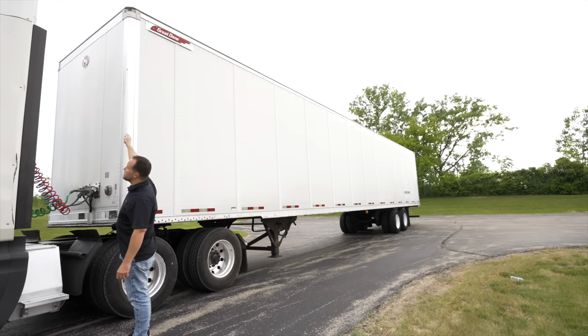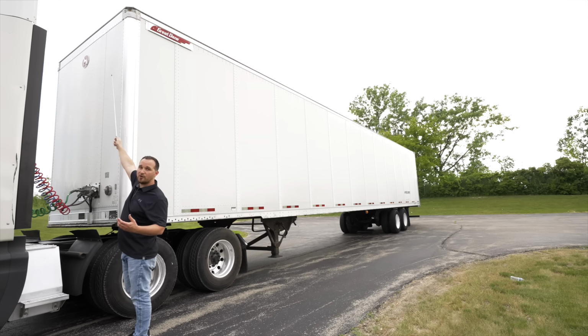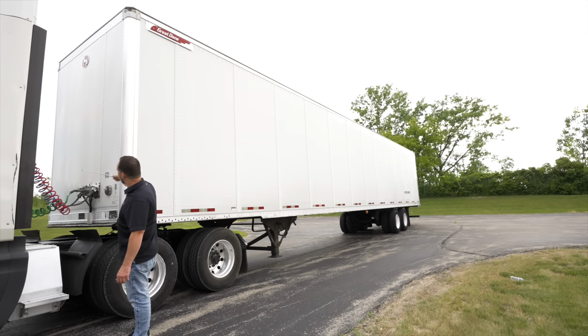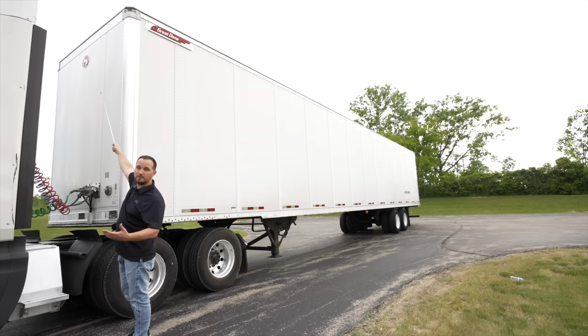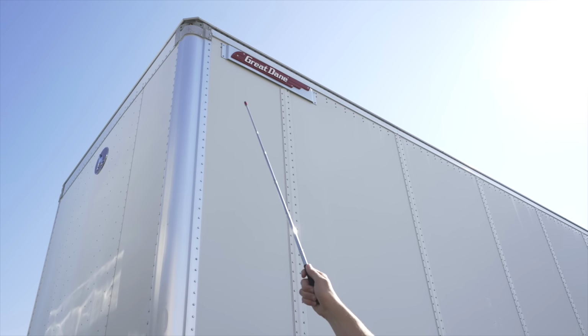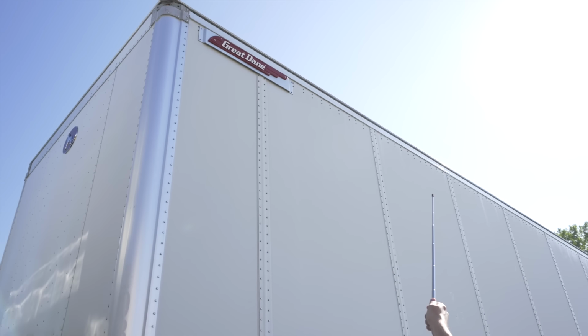I usually start from top to bottom. On the top of the trailer, the clearance lights, they're not broken, not cracked, on secure, proper color. They function as running lights. The front headboard of the trailer, it's not broken, not cracked, on secure, no holes, no daylight coming in and out of it. Then we're gonna go to the side of the trailer, start from top to bottom, from front